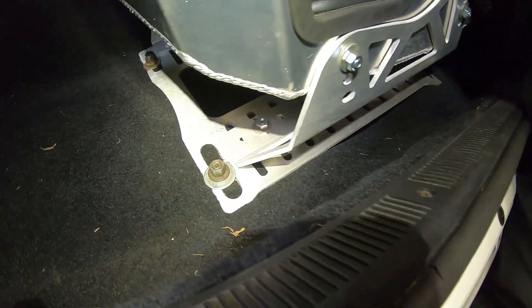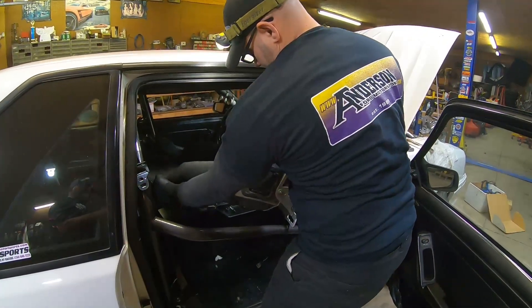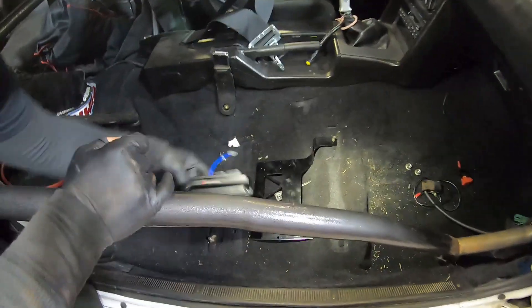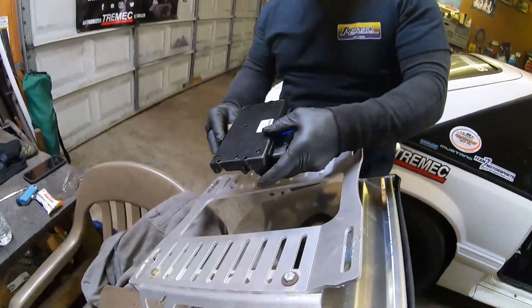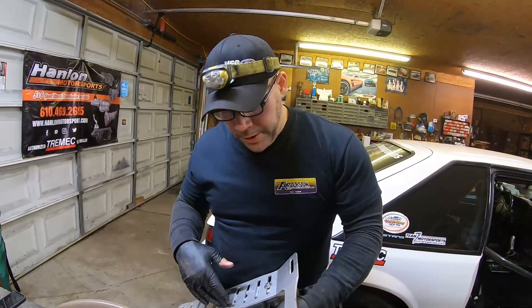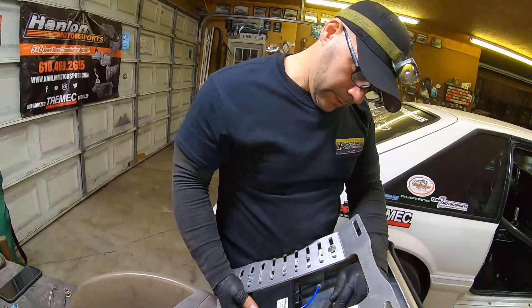Taking the seat out next. These are the Team Z aluminum brackets — we made studs all the way around. We're going to see if the Terminator X actually fits in the middle. The factory mount would go right here underneath the seat, but with the Team Z bracket it's going to hit the aluminum bracket — it won't be wide enough. What cousin Paul and I decided is to go ahead and mount the Holley ECU far enough back to where we can still get a belt through if we need to.